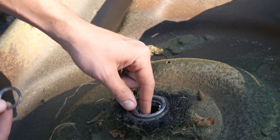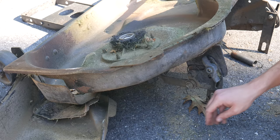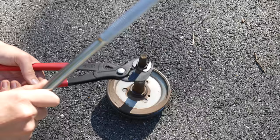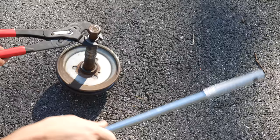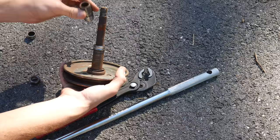After a few more taps we can unscrew the nut and fully knock the shaft loose, and once we lift up that splined blade adapter we find the remaining pieces of the bearings - that's a bearing cage but there are no ball bearings left to be found. With the shaft loose we can lift up the mower deck and slide it out of the way. Oh yep, there are the ball bearings - sure, those look good enough to reuse. The next challenge is removing the inner race of the bearing from the spindle shaft. If I were at home I would probably heat the race of the bearing, clamp it in the vice and hammer it out, but when you're just sitting in the driveway with limited tools you've got to work with what you've got.